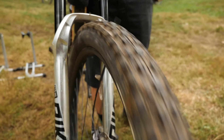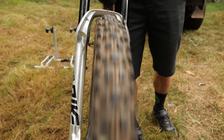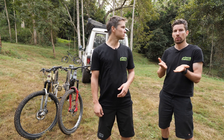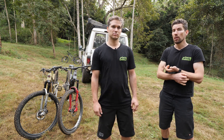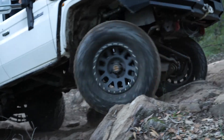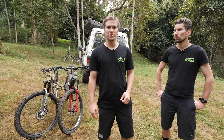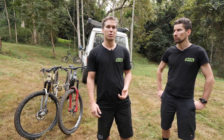One factor is tyre volume, based on width and wheel size — both wheel diameter and tyre width matter. If you're running a narrower tyre for cross-country or endurance riding, that might be a 2.0 or 2.1. At the other extreme for downhill racing, it's usually 2.5 to 2.7. It's very similar to a four-wheel drive — some tyres have a thinner casing and need higher pressure, while muddies tend to have a really thick sidewall and you can run lower pressures.